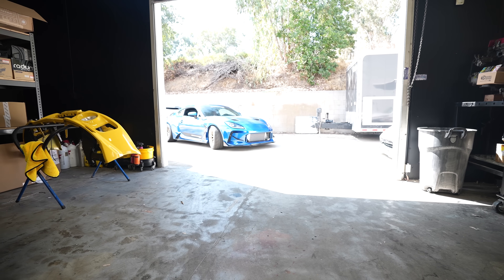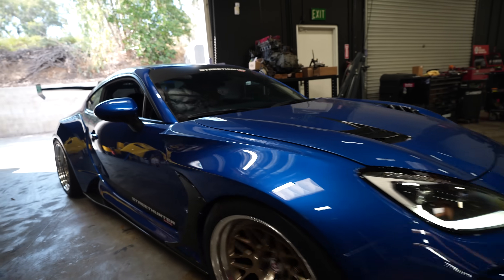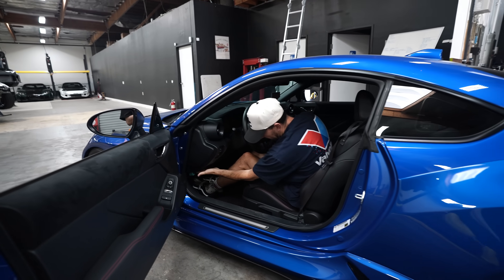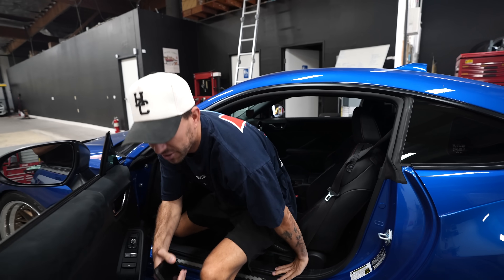And we start now — boom, we're off. I'm doing my best not to drive too heavy, although it's getting exciting because I can hear the turbo. It does surge a little bit under 5,000 RPM, and this thing is probably going to make peak boost around 4,500 RPM. I'm really trying not to get too close. This part is the least exciting part — once the map gets written, that's when it gets really fun.